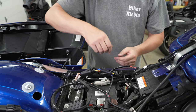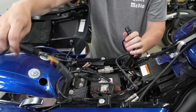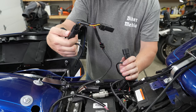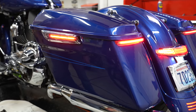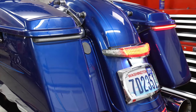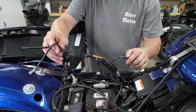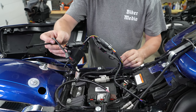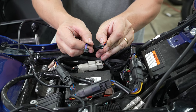Lurch has a whole bunch of other Ciro 3D lighting on this bike. Each kit comes with a new splitter and you just daisy-chain all the products on the rear of the bike — same up front in the fairing. That's how Ciro works: it's a CAN-bus plug-and-play system compatibility, just daisy-chained multiple times. Now we'll get the lighted hinge covers hooked up.